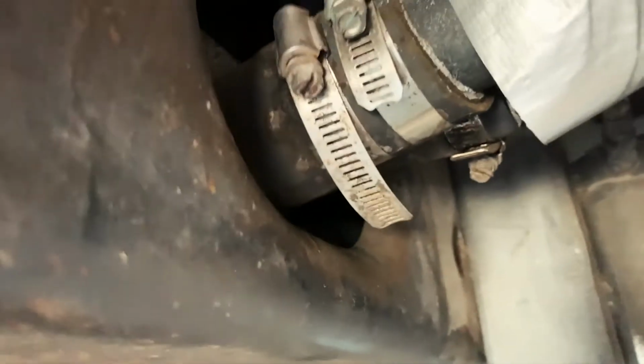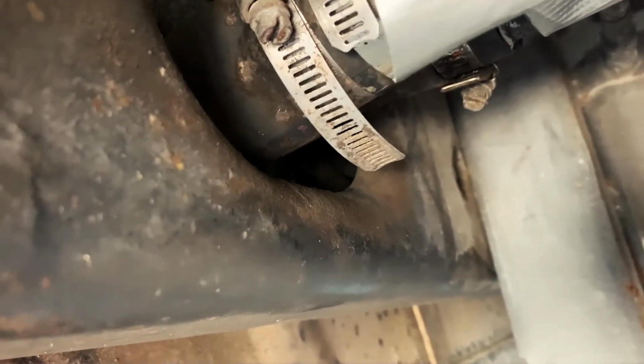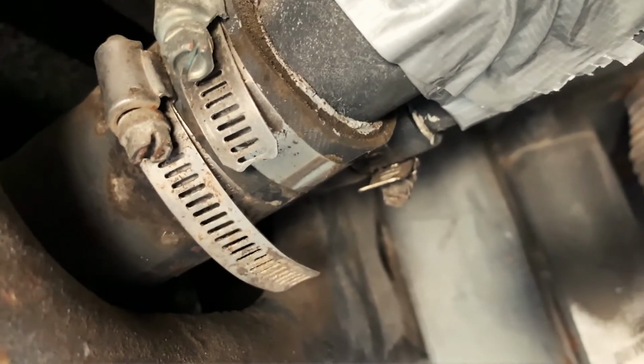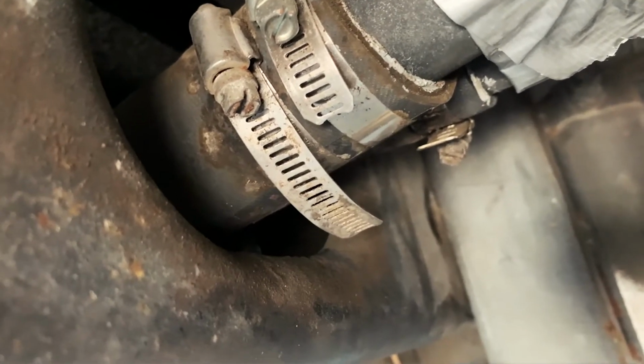Alright, so we just stopped to get gas. And inside here, this line, right here, right there, is falling apart at the gas tank. I got the gas tank full and I started hearing gasoline pouring out onto the concrete, stopped, crawled underneath, and found that what's holding it together is old rubber. That's probably what it should be, but it's just falling apart. So now I gotta get this 8-inch piece of rubber replaced soon.